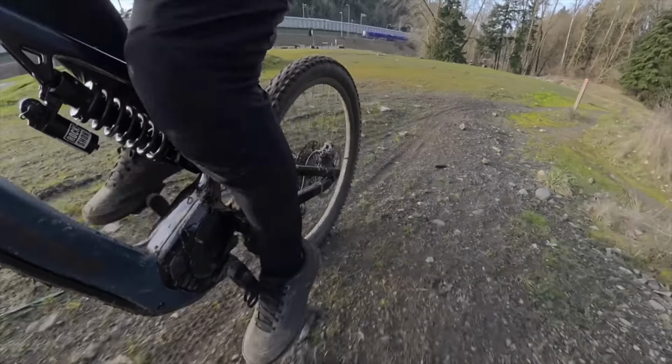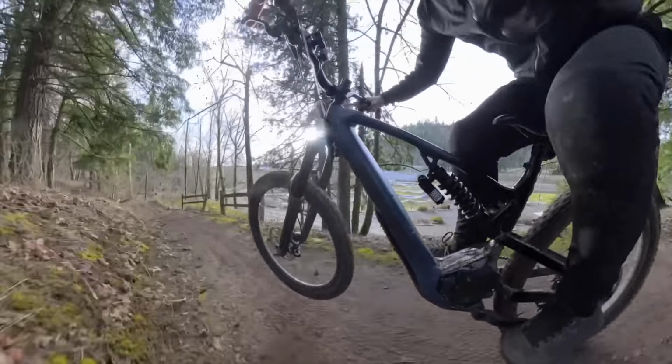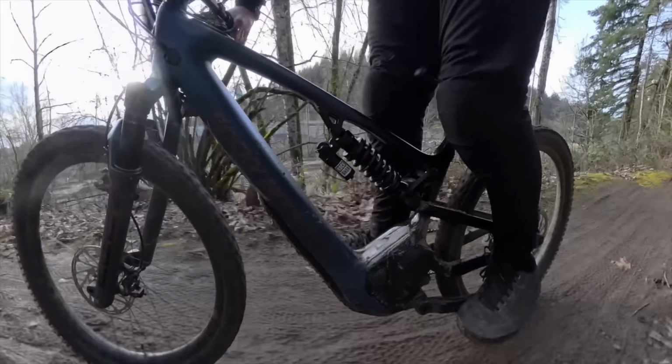With the middle hydraulic bottom out, I set through the same jump line. It's very important to ride the same track. So the bike is much better feeling on hard landings, and we can see the spring isn't collapsing quite as much as before. The difference between a poorly set up Rockshox product and a perfectly set up Rockshox product is very small, so it's arguable if turning the compression on is even worth it. A revalve, a retune, a reshim would give you much better results.